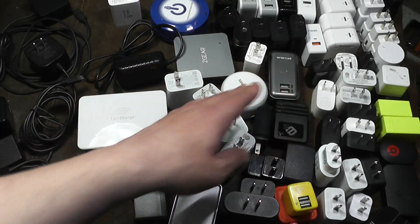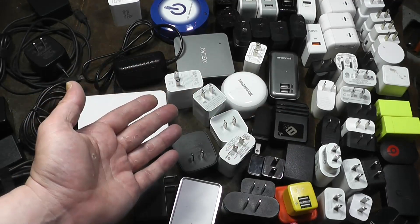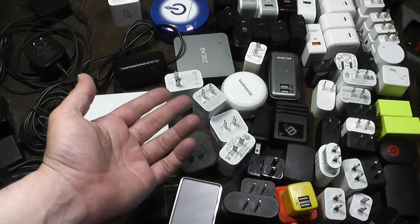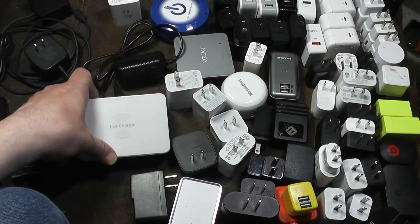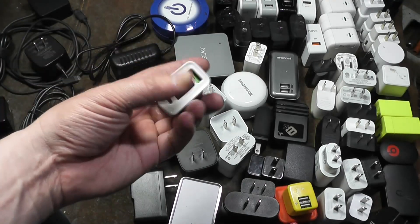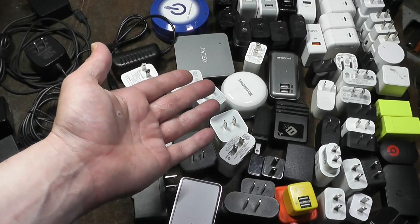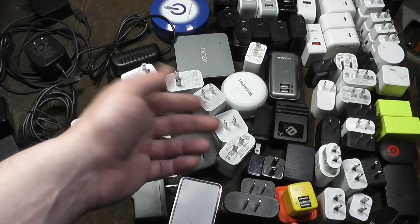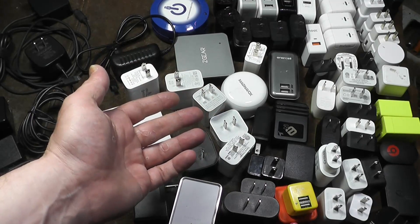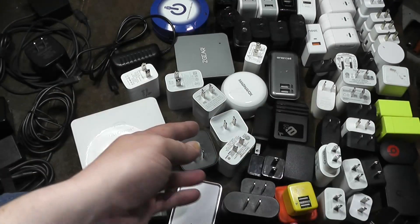That was the purpose of this video — a wide variety of all these different chargers. All you have to do is look up the label to really see how well they do. Many of them — pretty much all except a few — are going to be fast chargers. When it comes down to it, if you have a decent cable that isn't wearing out, that's one of the nice things about digital display chargers: if you have a cable that's failing, you'll see it's barely delivering any amps. Regular 10-watt, five-volt chargers will still charge devices pretty quickly; it's only when you really need to charge up fast or have a large battery bank that faster chargers become more of an issue.